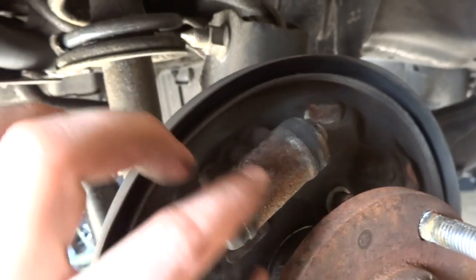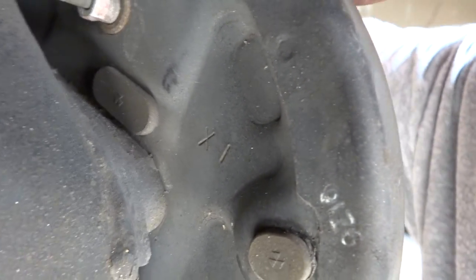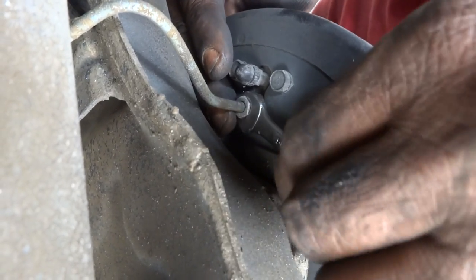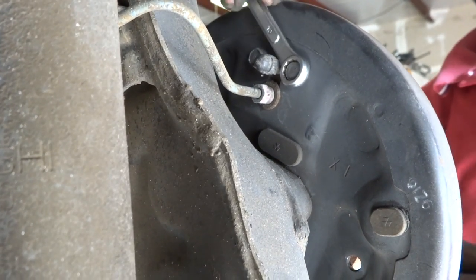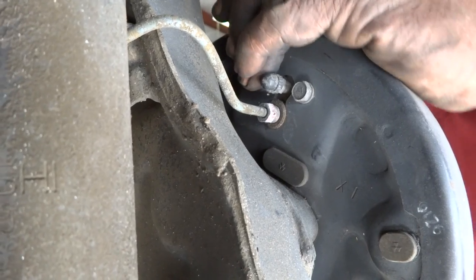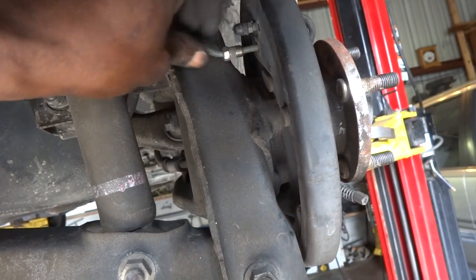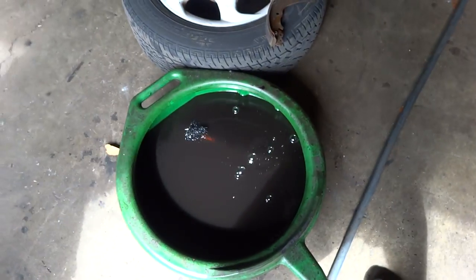This whole unit will come out. I suggest just taking off the brake line first and then the two 10s. So right now they're taking off the brake line — just loosen that up until it comes completely off. Now we're just going to take off the two 10mm bolts. We've got a little pan underneath here to catch the brake fluid, and there we go — see it coming down and we got it right in the pan.